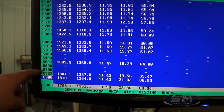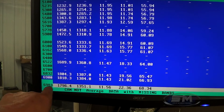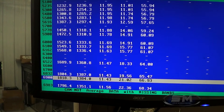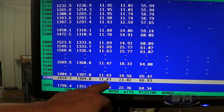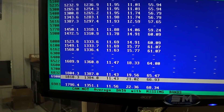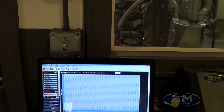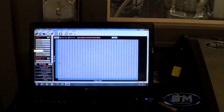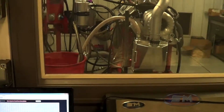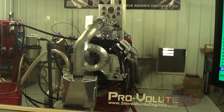Right through there it actually hits a real sweet spot where it jumps up quite a bit — that's where it's really getting happy on the boost. We have a rev limiter right at 7,000; it just starts tickling right there. At that point: 1,818 horsepower at 21 pounds of boost, 11.43 AFR. Our IATs are really good with the Holley system and the dual intercooler — IATs are really nice, we're just about 65 degrees with 70 degree water. Really quite happy with that.